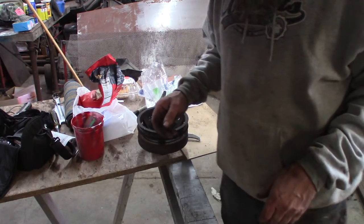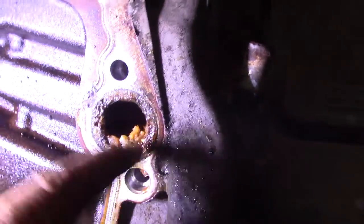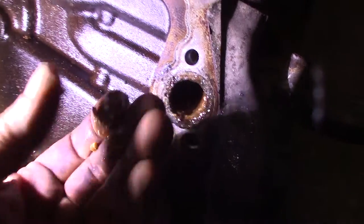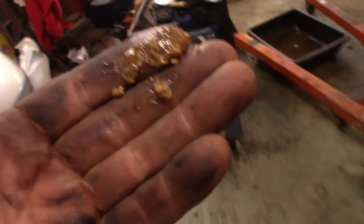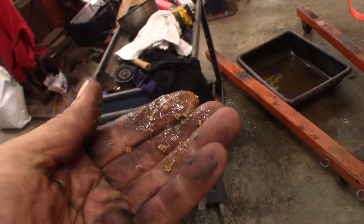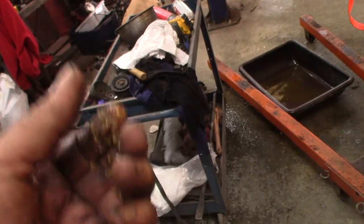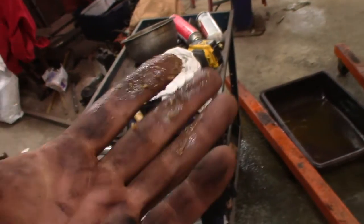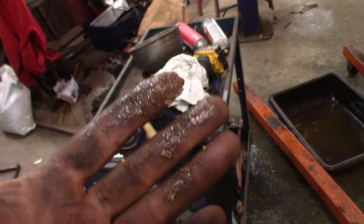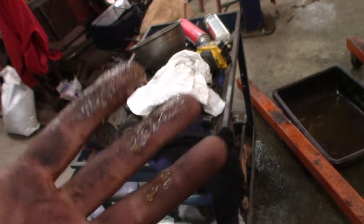I've done it twice now, once on each motor. Doing a little bit of an autopsy on this thing — that's a gooey mess. That's just probably from using the wrong antifreeze, starting to dissolve the metal. Or too long an interval on changing antifreeze — whatever your owner's manual says is the way to roll. Because antifreeze is important and it does tend to turn to an acid. It loses its pH balance and then you're screwed — starts eating everything.